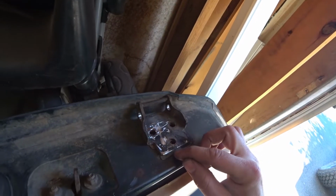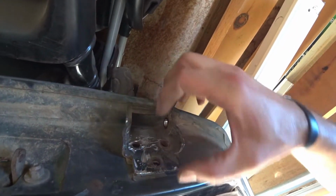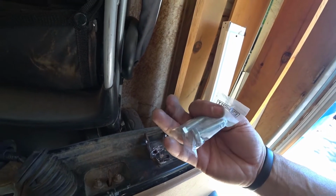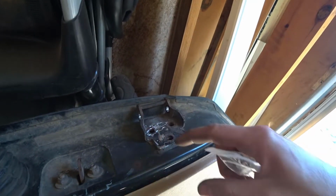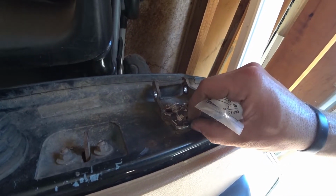Our freshly drilled hinges back in. You can see where I had trouble getting the bolts out, which is why we're going to be replacing them with some M8 by 1.25 thread, and I went and grabbed, I believe, like 2-inch bolts to replace these, because they come from the factory with these Torx bits, which I did nothing but snap Torx bits.